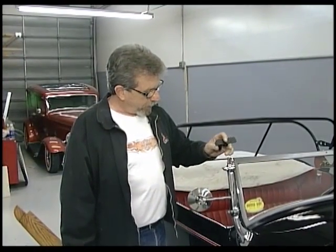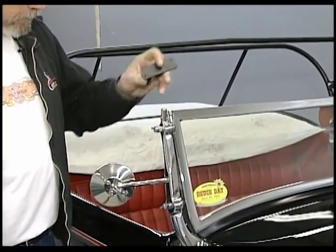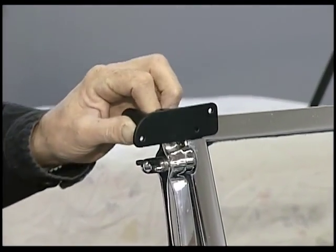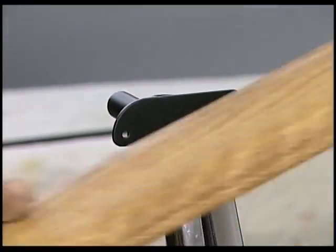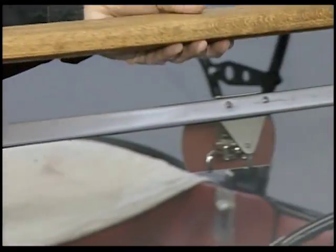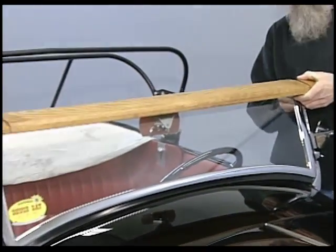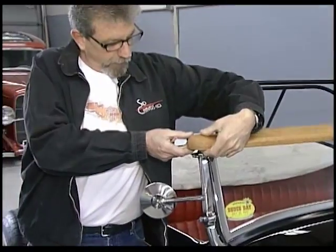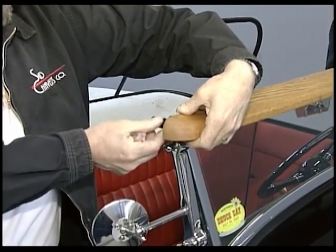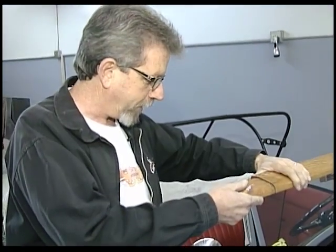On the windshield posts, there are a lot of different manufacturers. Some of them have a little keyway here that keeps the head piece from falling all the way down; some don't. You just set these on here — this one actually stops. Some will go too far, but that's fine because you can move them up to match on the header bow. Set both of these on the posts on each side. Set the header bow so it touches against the frame, then on this particular car we'll move it up just a touch so that it's level with the bottom of the header bow.